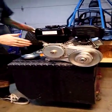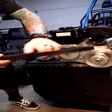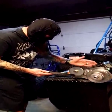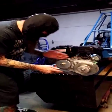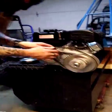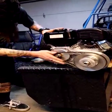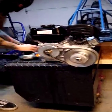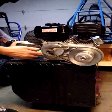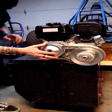Now you must take your belt and line it up. The belt has two sides: a flat side and a sharp side. The flat side has to go up against the pulley — otherwise there could be a lot of damage. So you slide it on to your torque converter and slide it over this little brass collar. That's going to hold it in place for now. Then you can take the rest of your clutch assembly and mount it onto the shaft.